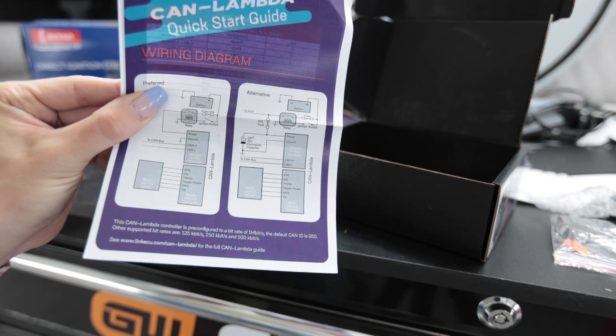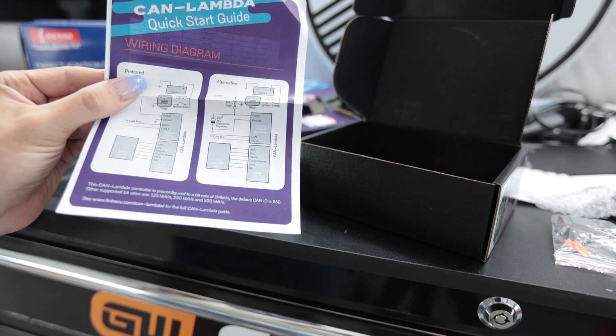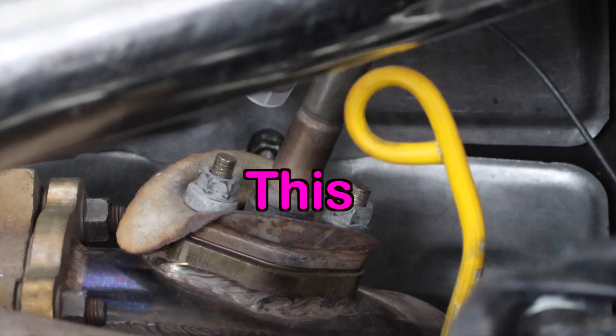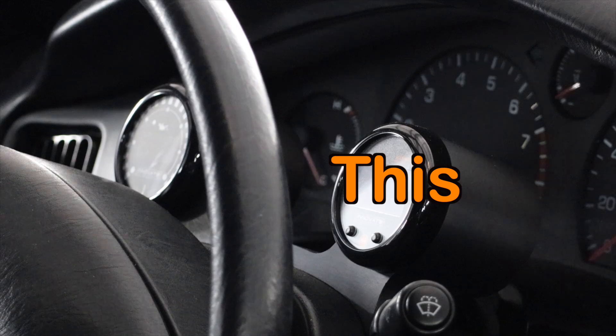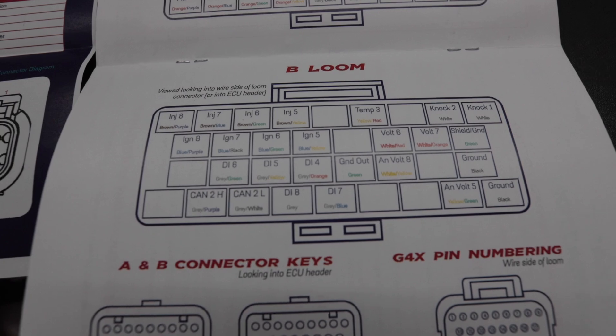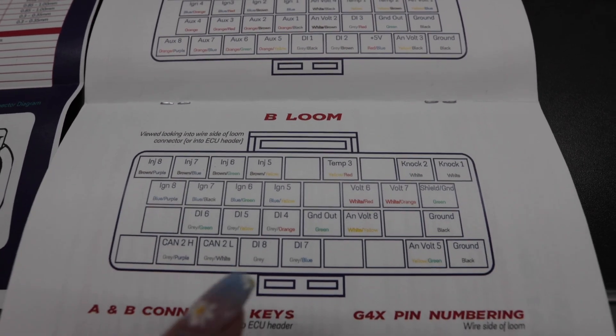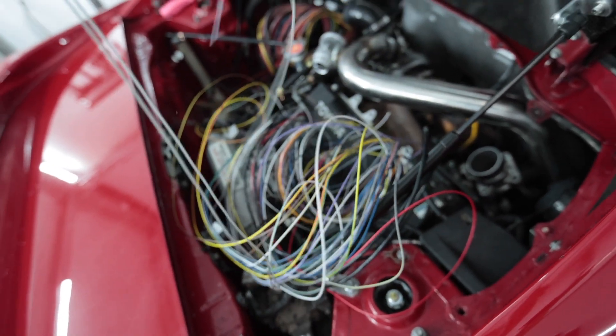Here is my missing Link — pun intended. This is what I needed so I can start doing the circuit for the O2. This will be the one up by the turbo, and then I have a secondary O2 a little bit further downstream that's hooked up to the SCG1, which is the electronic boost controller and wideband. I'm going to keep that in the car to act as a visual boost reference on my steering column, which also has a wideband gauge. So even if that's not controlling boost anymore because the ECU is doing it, I can still have it as a functioning boost and wideband gauge right there. My O2 sensor CAN-L and CAN-H are my two signals — here they are right here. O2 sensor, CAN-H, CAN-L — I know they're on Loom B connector. These two wires, grey/purple and grey/white, go to the signals for the O2.